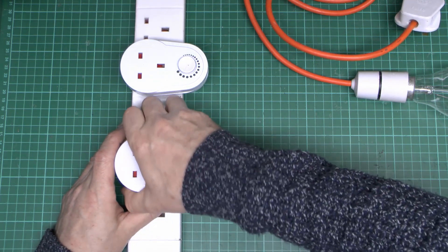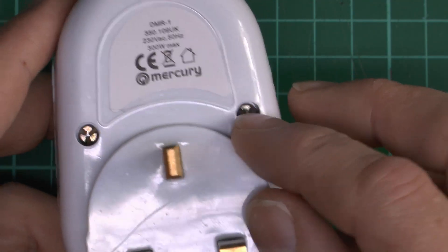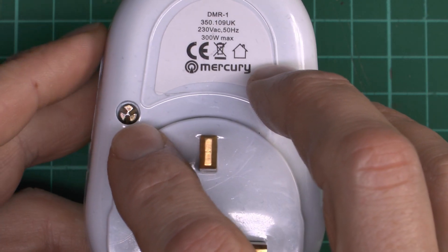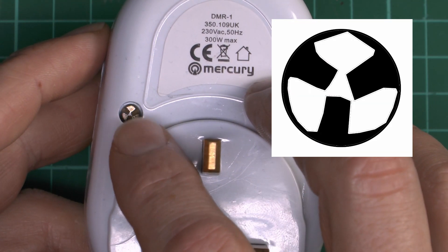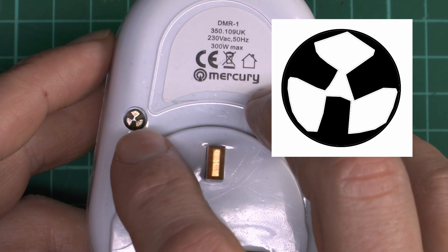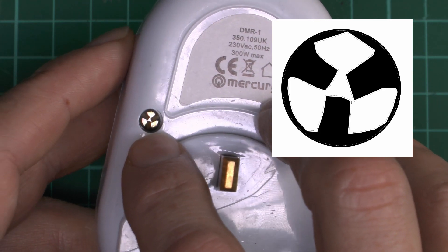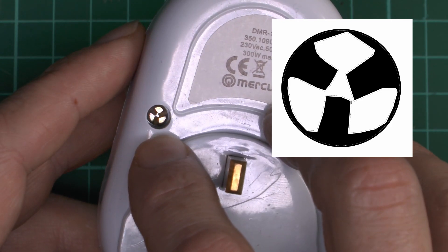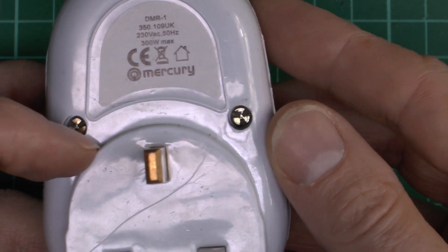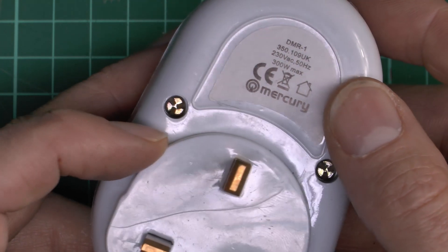So let's see if we can get inside one and see what's actually in there. Unfortunately, the screw heads are some other weird type — I don't have any bits that will actually fit these, and I'm not entirely sure what those would be called. It's not Tri-Wing, because that's basically three lobes. This is similar to Tri-Wing but the middle is solid, so a standard Tri-Wing bit will not fit. It's like a Tri-Wing but with a recess in the middle, which would fit over the solid piece in the centre. If anybody knows what that's actually called or where to get a bit for it, please put that in the comments. Both screws are pretty much the same — three prongs but with the centre filled.